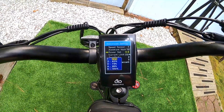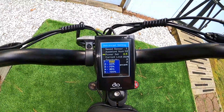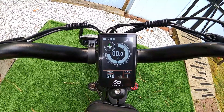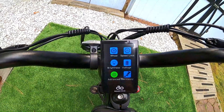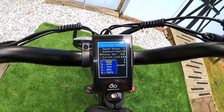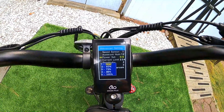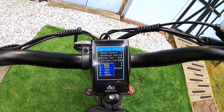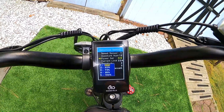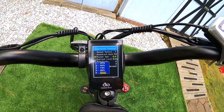Hit the I-button on Power Set and it turns yellow. You can set zero through three, zero through five, zero through seven, or zero through nine pedal assist levels — I like five levels. Push the I-button again and it takes you into how much power is delivered in each setting. When I got this bike, pedal assist one was set at 50% — I bumped it down to 20 because it was pretty abrupt. Pedal assist two was at 61% — I knocked that down to 40. The minimum appears to be 20%.